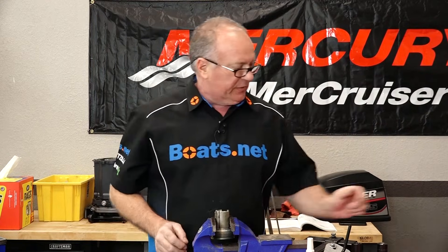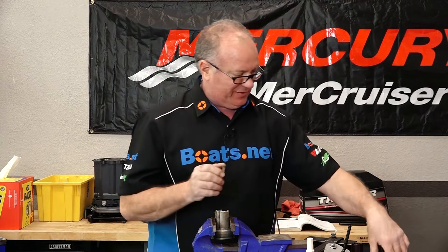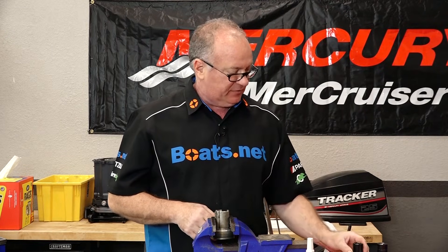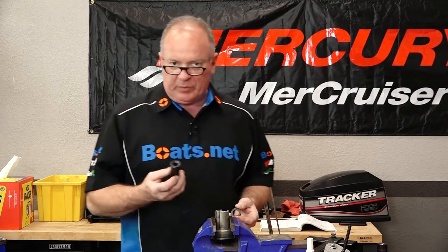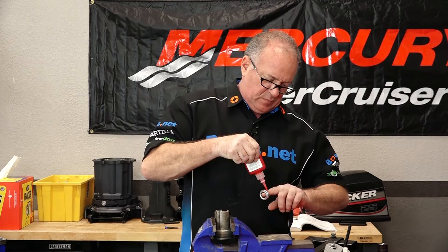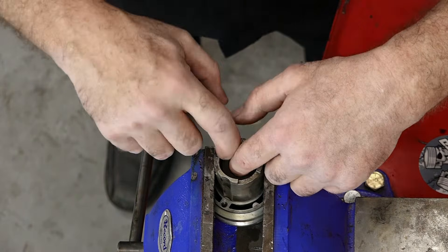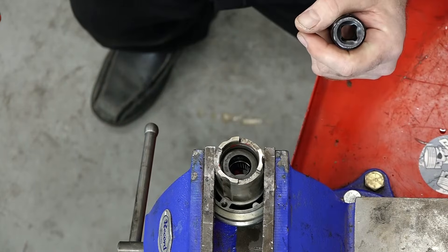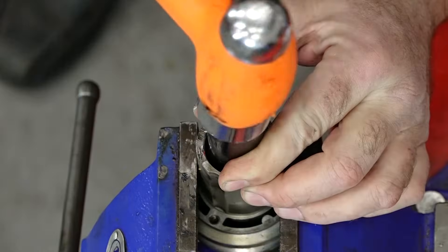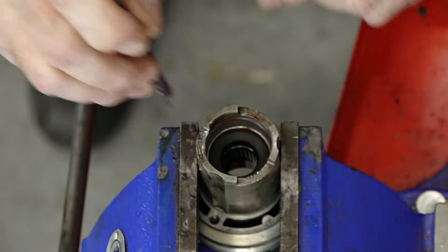There are various bearing driver kits out there but you're going to be pretty hard-pressed to find one that hits these two exact sizes. So I'm going to use a workaround — a couple of impact sockets, because these things get beat on a lot anyway. We're going to be using a 19 millimeter for the inner one. Let's make sure it's going to clear — and it does. Get on our Loctite, get it centered up. It's sitting in there a little bit cockeyed, so we need to go to the far side and square it back up. Bring it down an eighth of an inch past that lower edge and you're going to be on it.